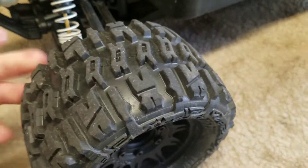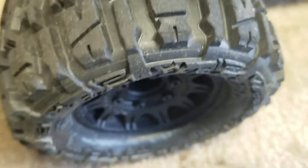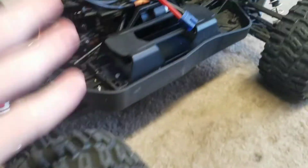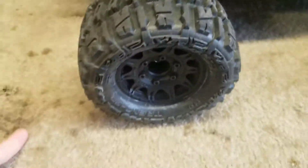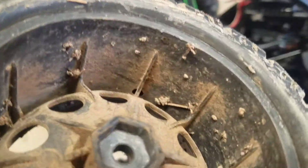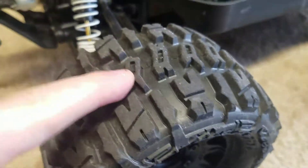You might think you have bent drive shafts. The first thing to do is make a little tiny hole right in the center of the tire, because that's where it balloons the most — that's where the most inertia is — especially on faster brushless basher vehicles. Water can get in through those little breather holes; there are two on this one.